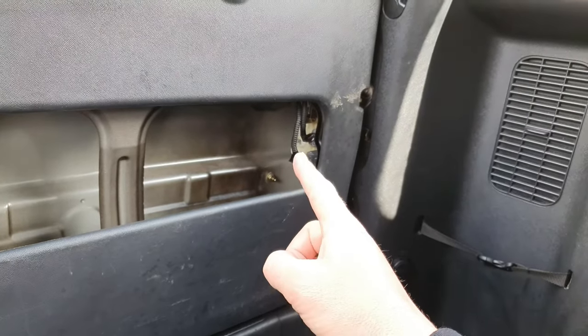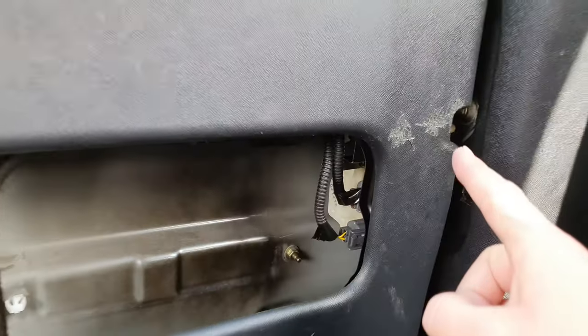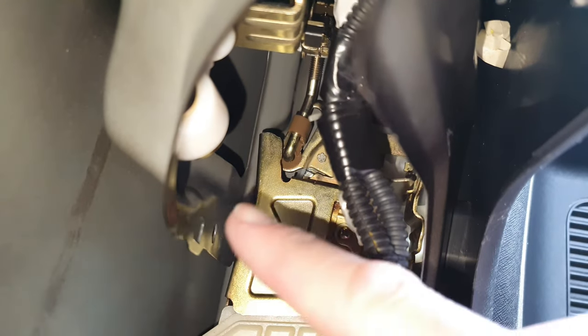If the door is locked — this is the back door — this is where I have to do this from. This back door would not open. If any of your doors don't open, it's because of the actuator that controls the locking mechanism — it either won't open or it won't lock. This goes in most Hondas. If you're lucky, this will break while the door is open, but in my case this broke while the door was locked. Whoever owned this vehicle before me obviously tried to get in at the lock but never managed it — you can see all this damage here where they were trying to get in at the side.